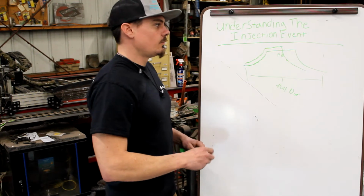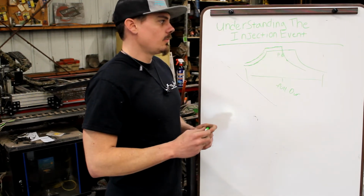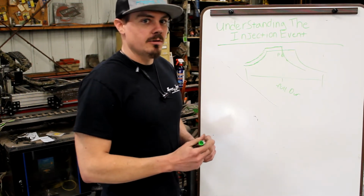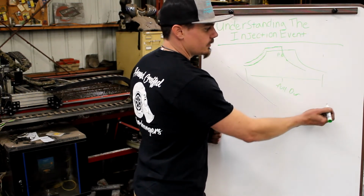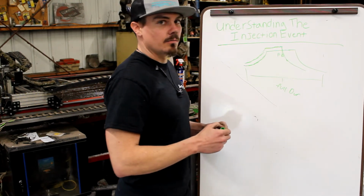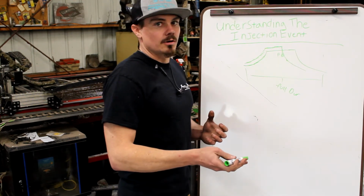And that's because we have run out of the injection pump's ability to maintain a full injection event in the system. And how to bring this across different platforms is in a common rail. What you guys say is that I'm losing line pressure. I can maintain line pressure up to 3,000 RPMs, and from 3,000 to 3,300 RPMs, I'm losing line pressure, and we'll notice that horsepower starts to fall with it, versus a system that can maintain the line pressure at 3,300 and 3,400 RPMs.